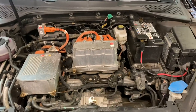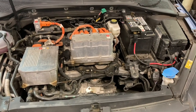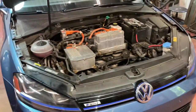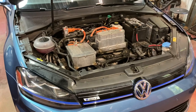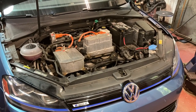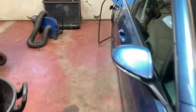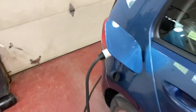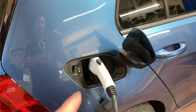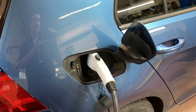That's pretty much all I had to do - install the new locking pin actuator and the coolant pump. I'll see if that pump fault goes away. Other than that, pretty successful installation. It wasn't very hard. If you have a car where charging does not commence or the charging connector gets stuck, it could be that little locking pin motor acting up.